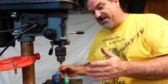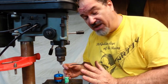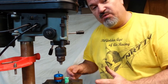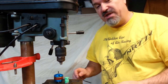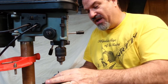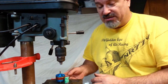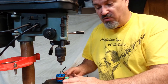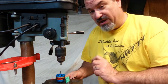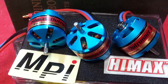I hope that helps. You can reverse these shafts and these motors very easily — there are all the proper procedures, everything you need to know to do it absolutely correctly. Don't make any mistakes, don't strip anything out, and you don't have to worry about it. It's an easy job — you can change them back and forth as many times as you like. Don't be afraid of it — get out there, fly, and have some fun. These principles can be used for other things in the shop you need to press together or apart. I wouldn't want to put any more pressure than that on a drill press — it's not really made for those kinds of forces. So an arbor press is a good investment for your shop. This has been Dave on the Crafted Channel — we'll see you on the next video.